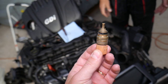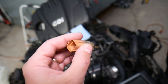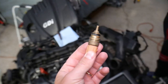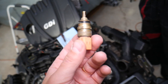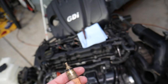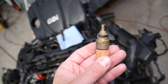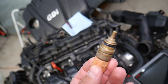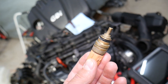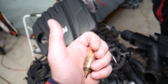Installation is exactly the reverse. When you put it together, install the sensor, put the locking spring back, connect the wire, and add coolant. But not just add coolant — you need to bleed the cooling system, bleeding the air out. If you don't bleed the cooling system correctly, you may end up with an air pocket in the engine that can cause it to overheat, potentially requiring an engine rebuild or a new engine. We'll have a video on the channel soon showing how to bleed the cooling system. Hopefully this video was helpful — thank you for watching and see you next time.